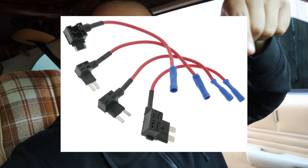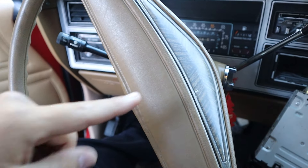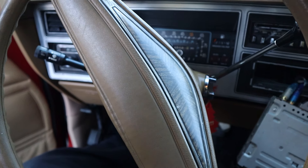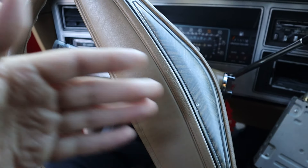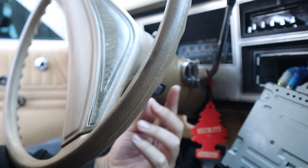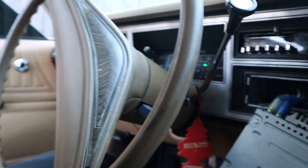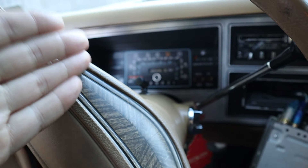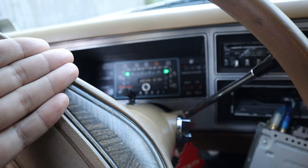You can use a fuse tap — we'll put a link below. Think about what in the car works while the key is off. Your horn is one of the main things that will consistently work no matter whether the key is on or off. You could also potentially tap into your hazard lights, because those work whether the car is on or off with no key — that's your constant power.